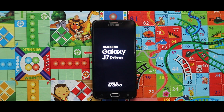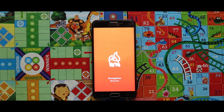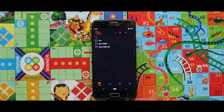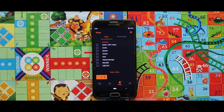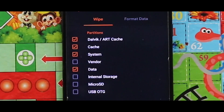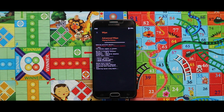For this installation you can use any kind of custom recovery mode — you can also use the TWRP recovery mode and Skyhawk as well. After opening your custom recovery mode, you have to wipe your device. Go to the third section called Wipe, then select Dalvik/ART cache, cache, system, and data. After selecting these four options, swipe the arrow to the right side.